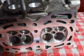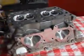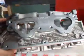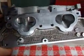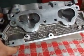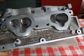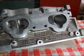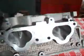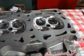We actually gained quite a bit of flow on this, which is kind of nice. The intake ports are looking real good here — it's upside down, but that's okay. On the intake we had a stock flow number of something like 236 CFM. On the exhaust we had 156 CFM on the dogleg and 165 on the straight port.